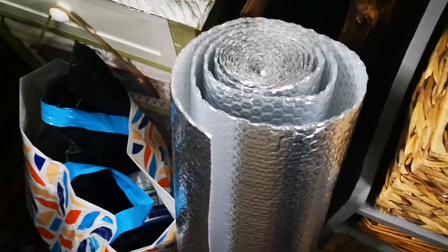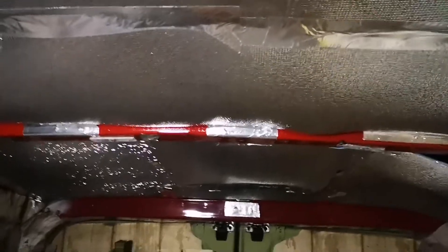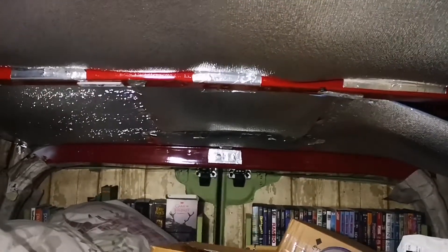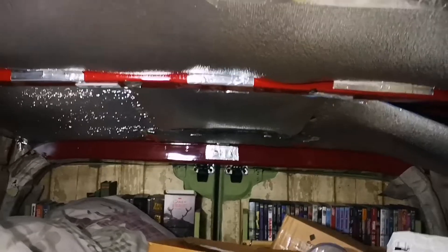So on the ceiling there's a layer of that as a sound deadener and insulation, then the dense foam foil-backed foil side down, then the Dodo recycled bottle fleece, and then it's going to be tongue and groove over the top. I've done this section this morning, this foam stuff has been up a while. I'm only going to do this section for now — done the front section, doing that section. The back section has a 400mm roof vent going in.